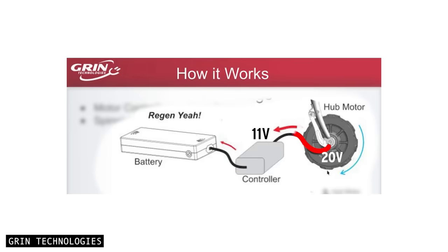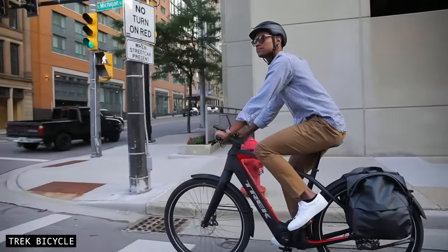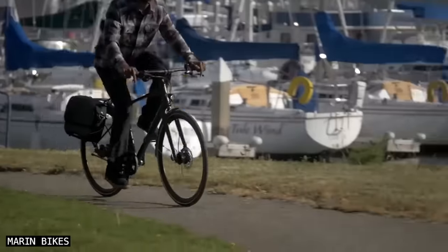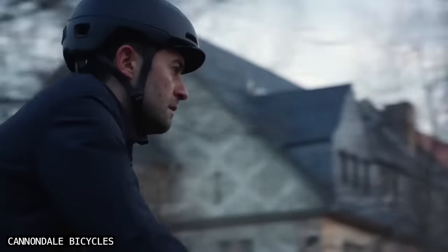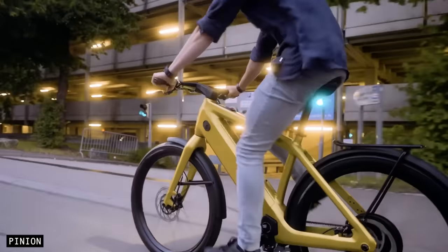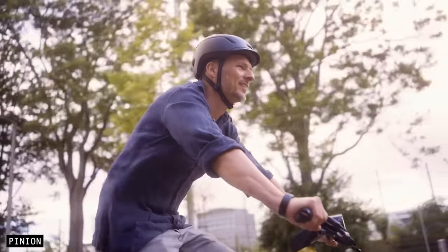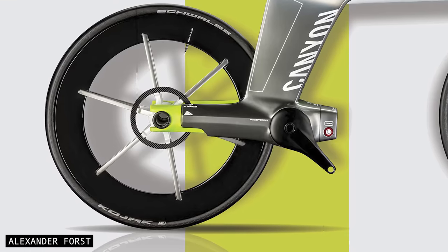This is something that wasn't factored into the earlier efficiency estimate. In stop-start situations, digital drive bikes can be quite efficient. Edgar also determined that his drive system would keep up with regular chain drive bikes on a stop-start city commute, provided the digital drivetrain had an efficiency of around 70% and he could use regenerative braking. But perhaps it's not the bike that needs the efficiency optimisation, but rather the human. Our bodies work most efficiently at a nearly constant load rather than a highly variable one. A digital drive could always select the right gear ratio and cadence for different riding situations, offering the most efficient extraction of power with the lowest levels of body fatigue.